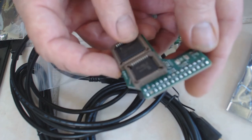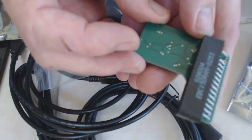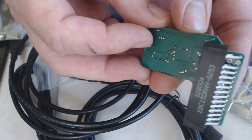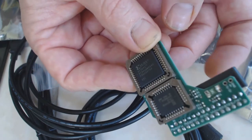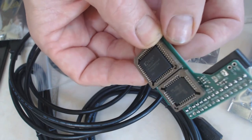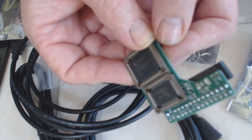In my case I was going to increase the engine size in cubic inches in the car, so it made it mandatory to find some means of tuning the computer. Obviously I had to have it burned to an EEPROM chip. There are several outfits that just sell these chips and you can have them programmed by providing a lot of information, but I decided I'd rather be able to do my own.